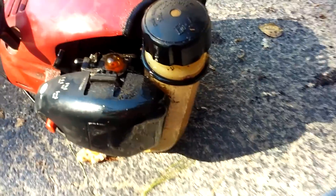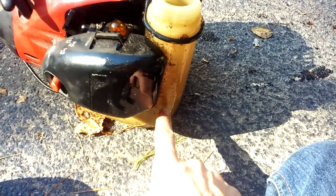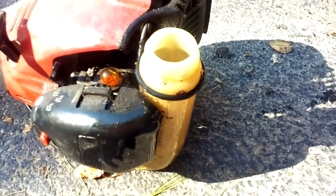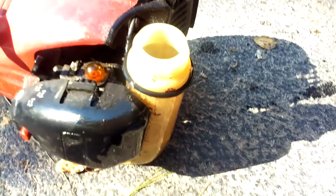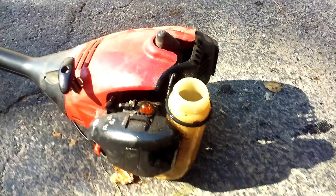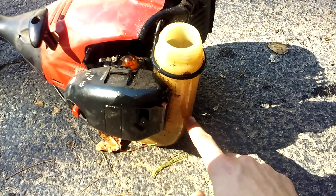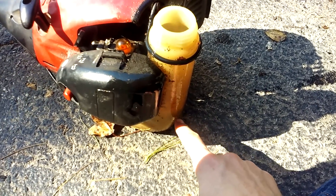I've been experimenting a little bit. What's in the tank right now? Well, at first it was about right here on a two-cycle engine — two-cycle gas, I think 40-to-1 mix. Then I was thinking, hmm, I wonder if this would burn motor oil, so I poured some 10W30 motor oil in there. I filled it to about right there and it ran all the way down to about there again, which is basically empty.